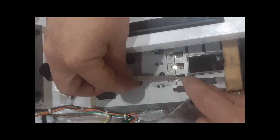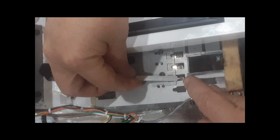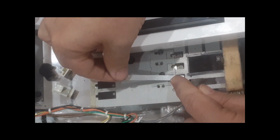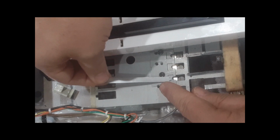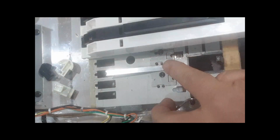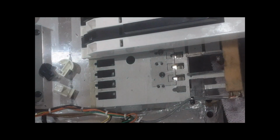But the problem is, look at that. That spring is right next to the switch, and sometimes when you're trying to get the key, this flips up and slips down under there. Now, when the spring slips under there, don't lift up on the spring, because you're going to push down on the switch. Pull the spring gently out. And you're going to need a magnet too. That's another thing you should have, a magnet, because if the spring drops down in here, especially between keys, the magnet is an easy way to get it out.